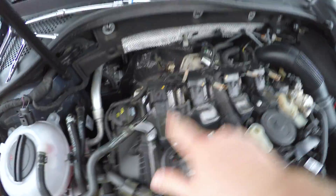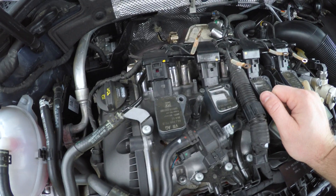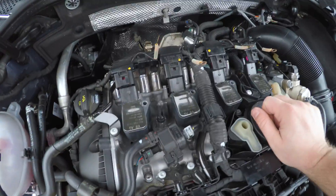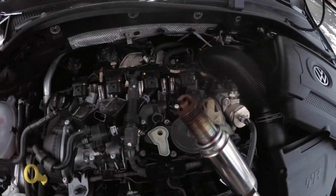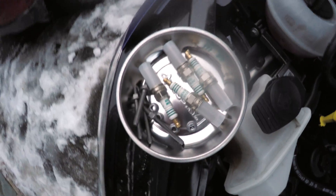Now, before we actually go to pull these off, I've already unscrewed them. But in order to keep dust and dirt and any debris out of the engine and out of the valves, it's really good to do these one at a time. So once I yank this out, let's do this one and then go one at a time through all of them. We have our first cover out. We're going to use our special sticky magnetic spark plug socket with the extension, put it down here, and we have taken out our stock spark plug. Now we'll just put the replacement plugs right back in.